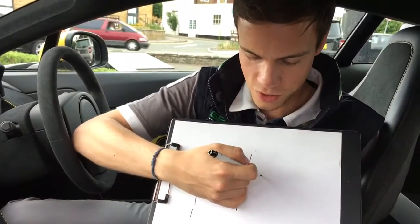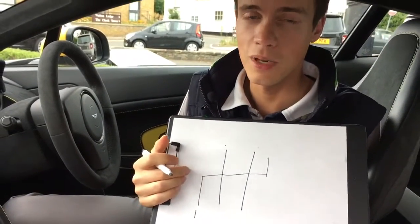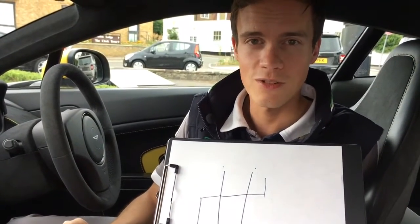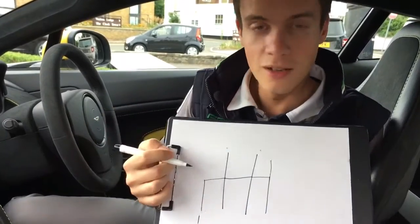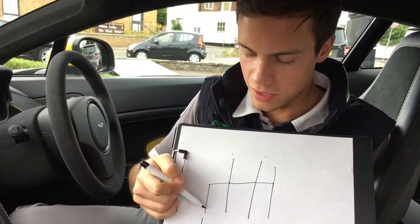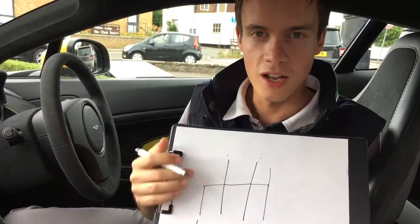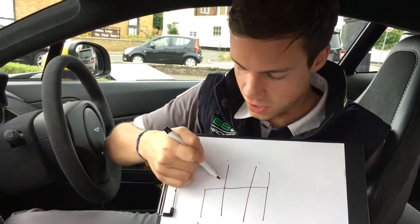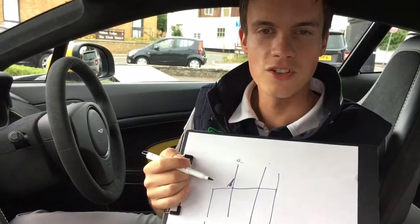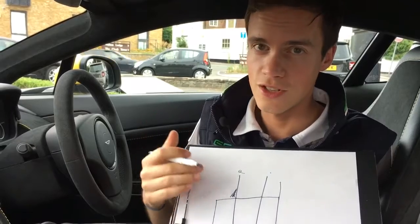Now, as 6-speed gearboxes entered the market more and more, this whole layout and configuration became completely impractical and unnecessary. But now that we're in the realm of 7-speed manual gearboxes entering the market, suddenly a dog leg becomes a suitable proposition again. Now, one thing that is the case with a dogleg gearbox is often they can be difficult to drive quickly or go for furious 0-60 times. But Aston have been quite clever, and within the gate they've actually cut off a little bit between first and second to make chasing those 0-60 times easier, and also driving of the car eminently easy too.